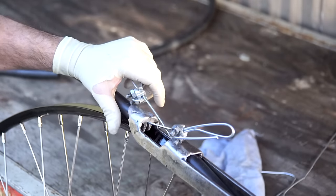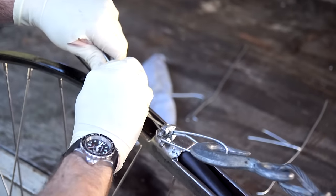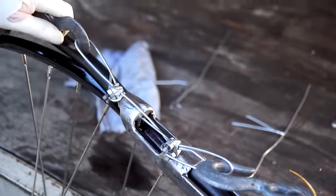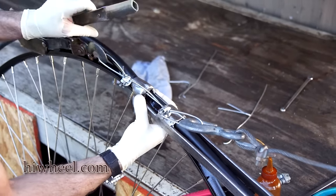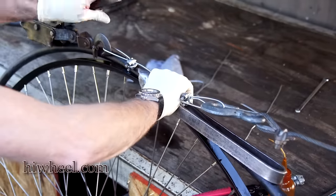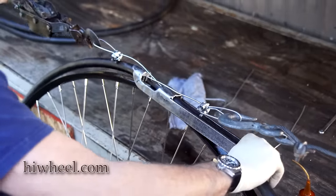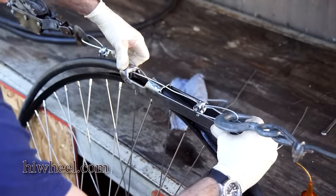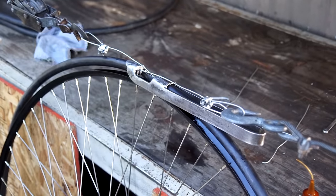So we got our wire through, and it's ready to cross and ready to put our hooks in. So there's one there, and stay. Hook up that wire there, pick up my slot. Make sure everything is set in position proper. Now, as you see, as I start to draw this wire, the tire starts sucking down onto the wheel. Now you got to make sure your wires stay in position and it's all set. Once it's all set, you're ready to put your final draw on it.